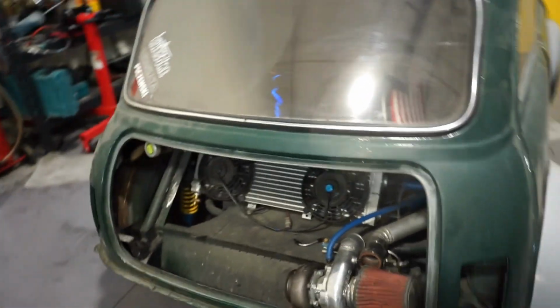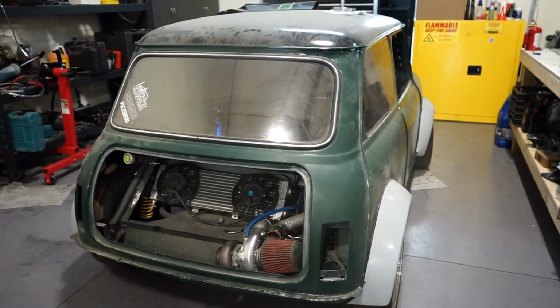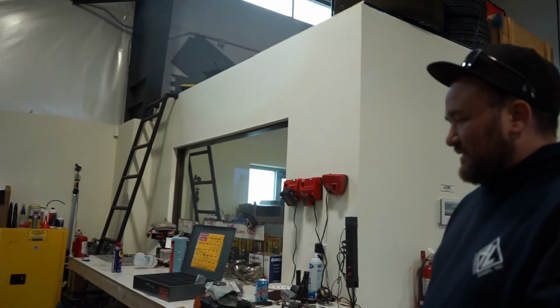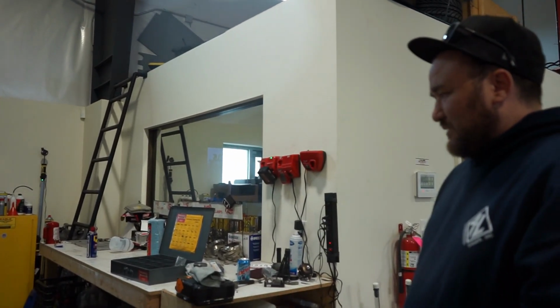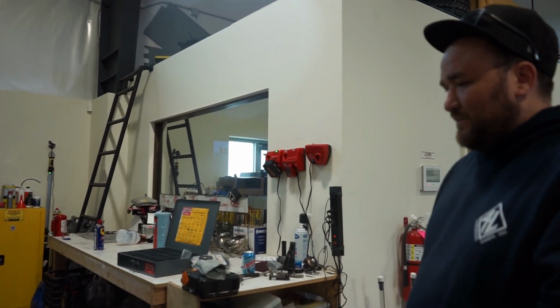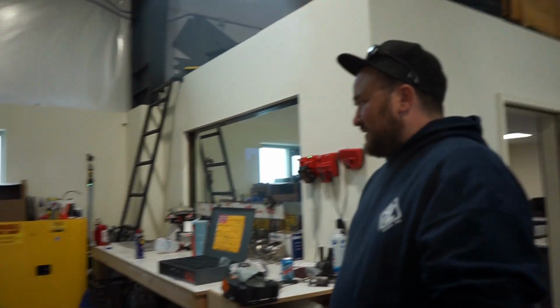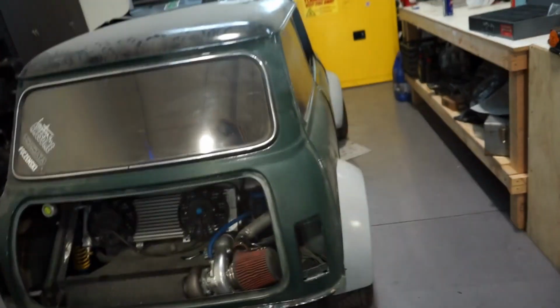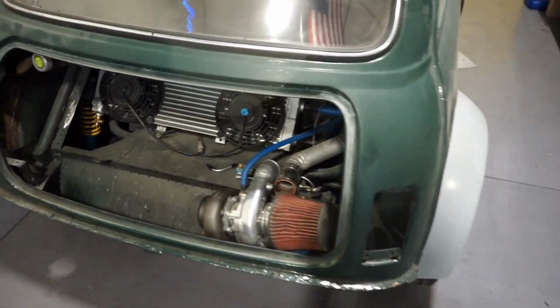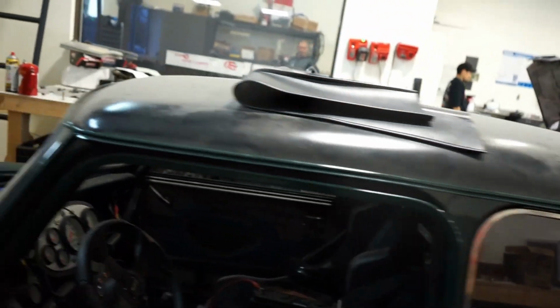That's alright. What about this guy? Can you tell me more about this? It's a B-swap classic Mini Cooper that's got an all-wheel drive drivetrain out of a CRV, some Land Rover parts in it. The suspension's composed of a bunch of aftermarket tubular stuff with some Miata parts and some Honda parts, and it's got a Benson sleeved 2-liter GSR in it. Is it in it right now? Yep. It's in the process of getting finished up.